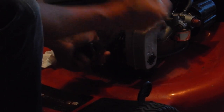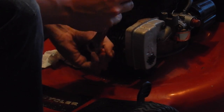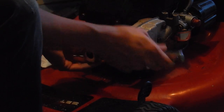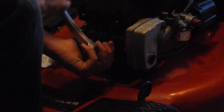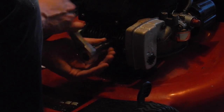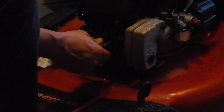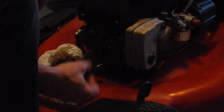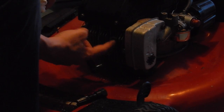And then it gets really, really loose, so I'm going to back it out and then go back in. You don't want to go too far in because you don't want to come into the piston and damage it. Pull it out just like this. As you can see, there is a whole lot of dust and metal on there. And as you look in here, it has been re-threaded — and that looks great.